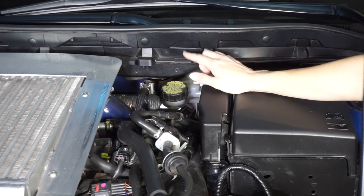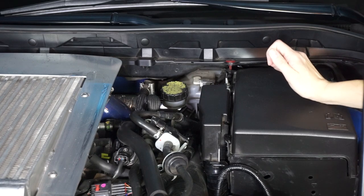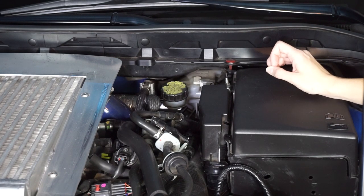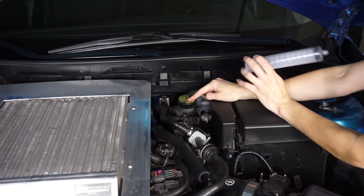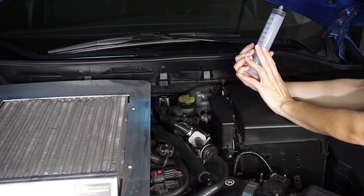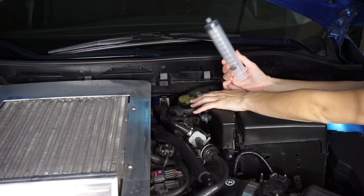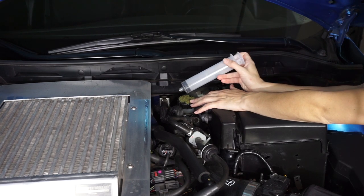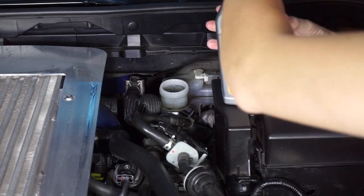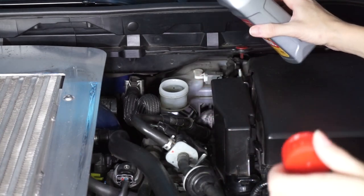First we're going to locate our master cylinder. For a lot of you this is going to be the exact same master cylinder for your brakes. For others the unit will be completely separate, so please read your car's manual to find the correct unit. Now you can remove the cap, put the syringe in, and take out as much of the old fluid as you can. We can't do it this way because we're blocked by a filter, but if you're able to get in there, just get the syringe in and take out as much of the old fluid as you possibly can. Once all the old fluid is out, start opening your new one and filling it up to the max line.